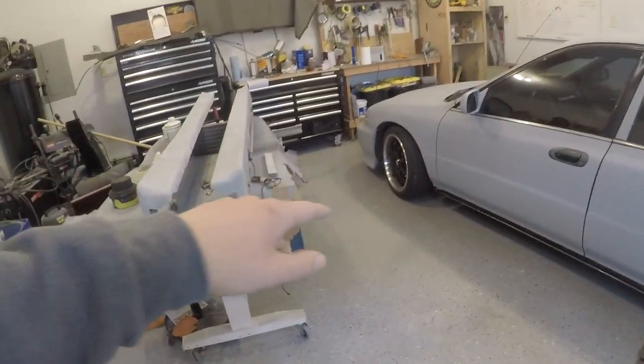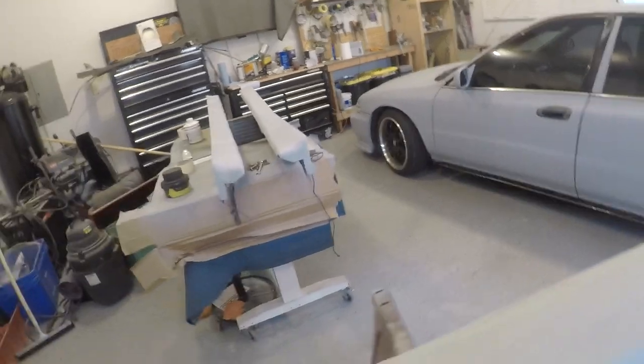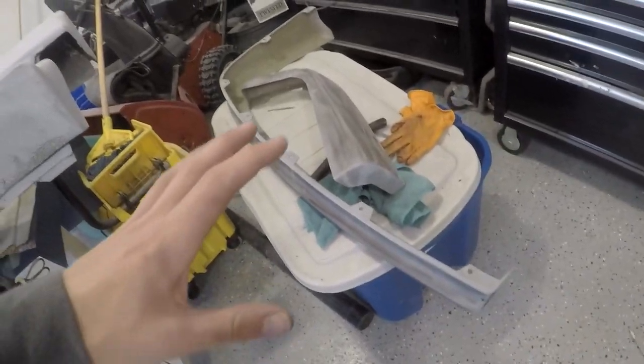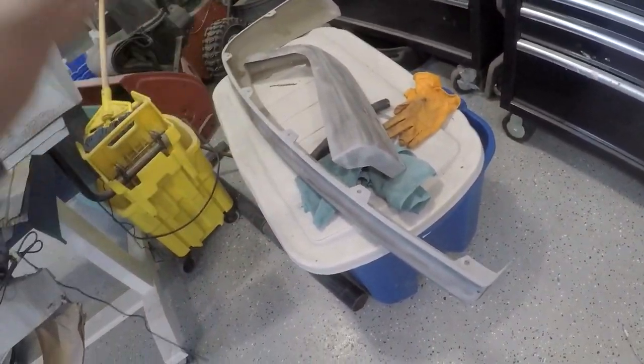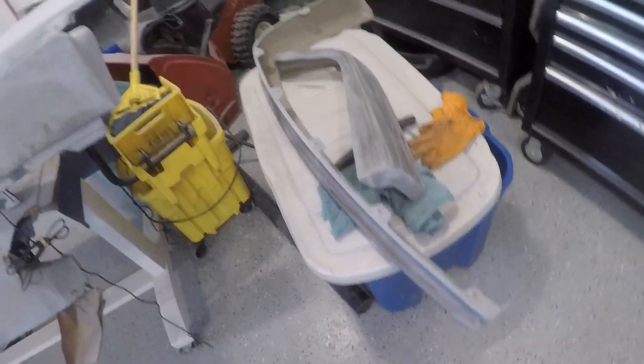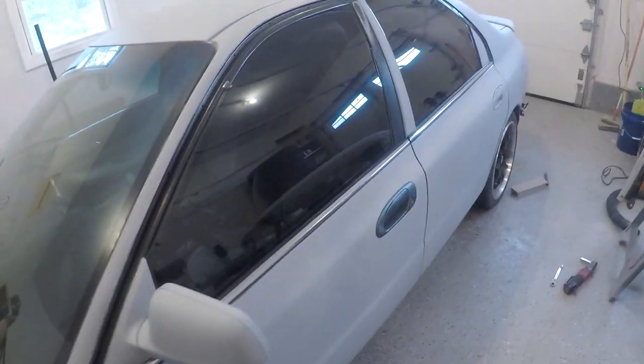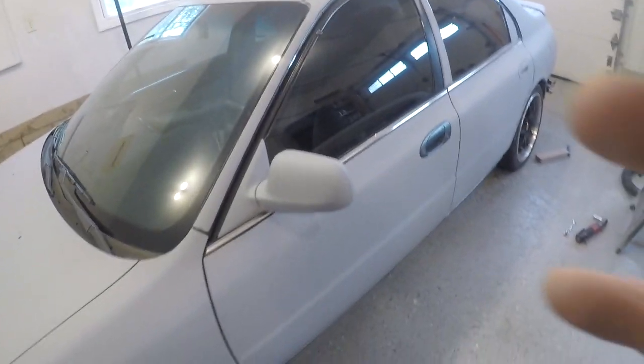I'm going to do the same thing with the front bumper and the grill and the front lip. So the lip I ended up sanding to make it smooth as well. But the rear lip was already pretty smooth, so I'll take a look at it. But this should just be ready for 400 and then 600 and then some paint. So this is ready to be primed once again. These skirts, I'm trying to get all the finishing touches done so that we're ready to go all at the same time here. So I've gone a little bit further.